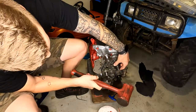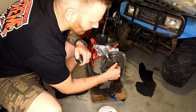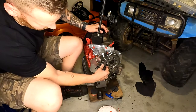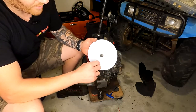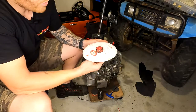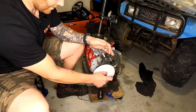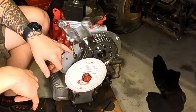Just give it a couple of light taps. Now you can see that the surface is starting to come through with the camshaft. Grab the new nut and wind that on — it doesn't need to be tight just yet, just nip it up by hand to push the camshaft sprocket on. The crankshaft sprocket is all the way on and the camshaft sprocket is on. Now we need to grab our degree wheel. I bought this one from Mini Sport down in South Australia — it was undersized on the inside so I just drilled it out a little bit, grabbed the crankshaft bolt and drove it straight through. As long as it can move freely and it's not overlaid around the inside of the degree wheel, you should be fine. Just tighten that up by hand — no tools whatsoever.